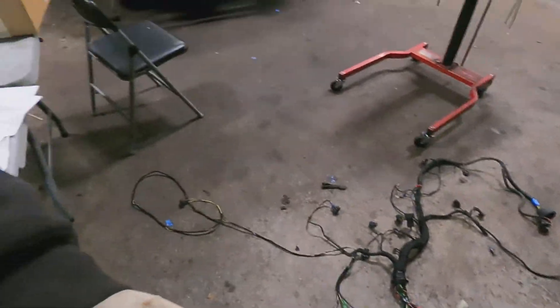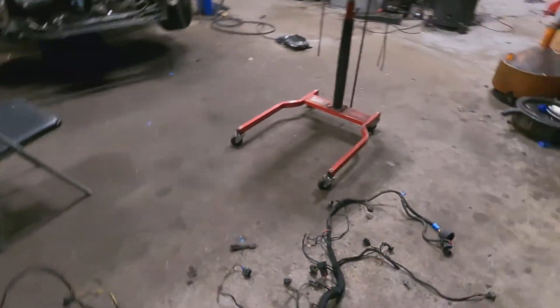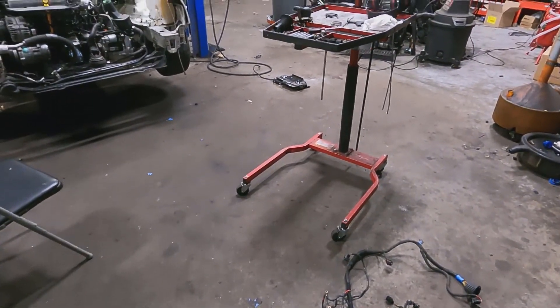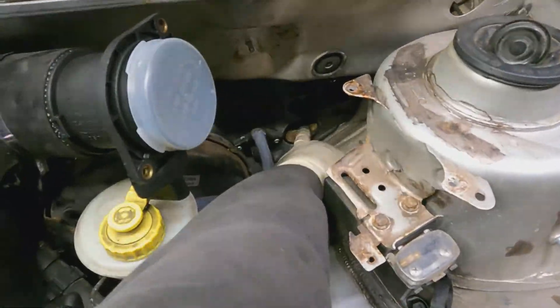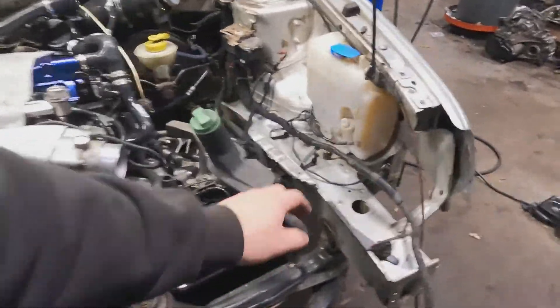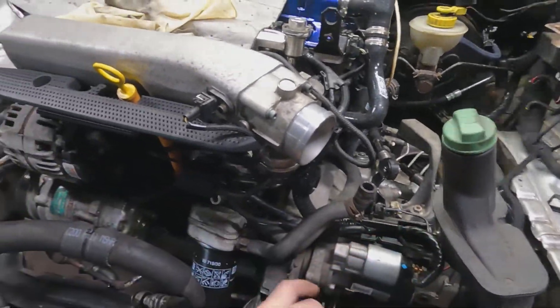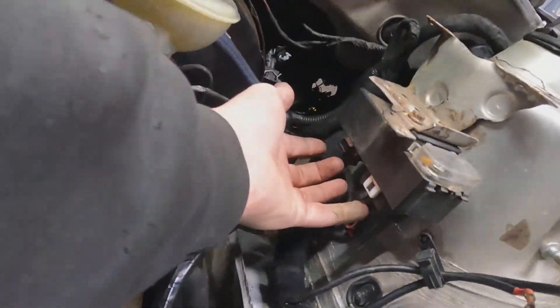Back again the next day, still on the wiring — a lot to do. I've gone back over some wiring and figured out a few more wires that have to be dealt with, but the chassis side is good to go right now. I'm going to put the chassis harness in through one of the multiple holes in the firewall for the engine side stuff. The chassis harness is fully in — you can see it runs up here, nice and tucked away. It's connected to everything: alternator, starter, reverse light, AC pump, and it follows with the nice OEM plastic down there and plugs in perfectly to the fan control module.